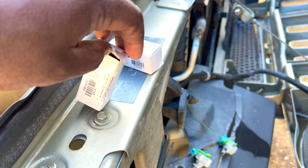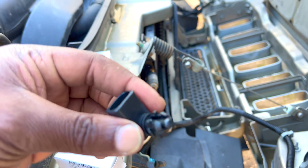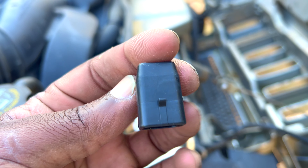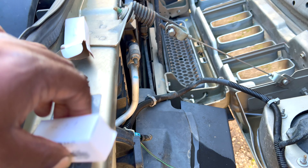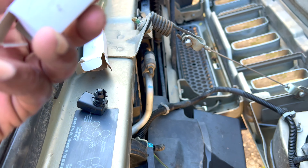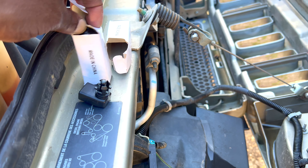This one is still pretty much in place. The issue I've had is that over the past couple of days or weeks, randomly, I would get a 'possible icing conditions' warning — and it's the middle of summer, even though we have fall colors already showing up here. Temperatures were not freezing or anywhere close to freezing, so I knew it was time to swap out these ambient temperature sensors.